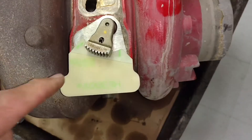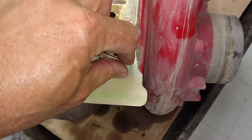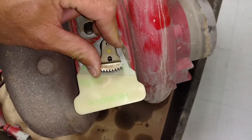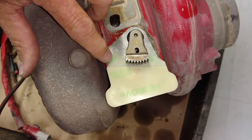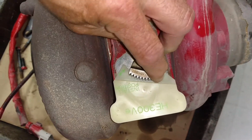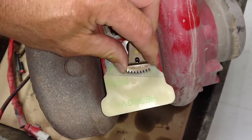If you have a turbocharger where you took the actuator off and you can move it by hand, you still need to put this guide on and use it by hand — there and there. That right there, this shoulder, needs to go right there, and I can't get it there. Probably with a pair of pliers it could, but that's not what you need to do. This should all feel free by hand.